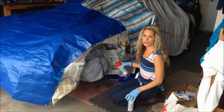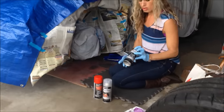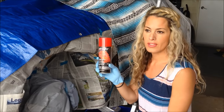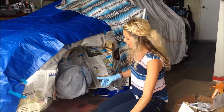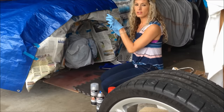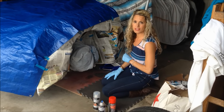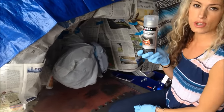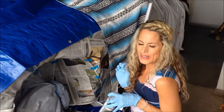I just put my first coat of primer on. Three coats of primer, wait 10 minutes in between each coat. Then I wait 10 minutes and start with the color. After three coats of the color, I wait a full hour before I place my transfer — it's like a sticker but you leave the vinyl on there. This part goes really fast: 10 minutes, 10 minutes, 10 minutes for primer; then color with 10 minutes, 10 minutes, an hour. Then I finish up with three coats of gloss, 10 minutes in between. Then we're done — I just let it sit overnight and the next day I have a gorgeous shiny color.